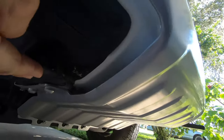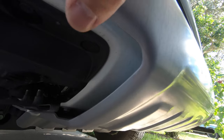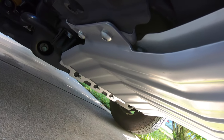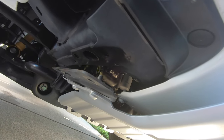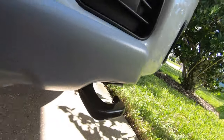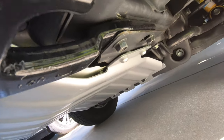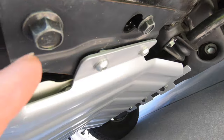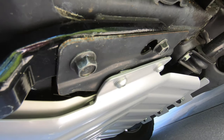I've got a 4x, so maybe this is extra. This big silver pan thing — I guess that's what you call it — a skid plate. That's what it looks like when you haven't done anything yet. There are the two bolts — one, two — pull those two bolts out and this will slide right out of the way.